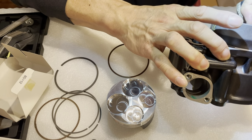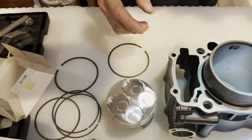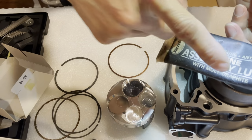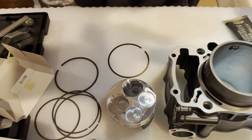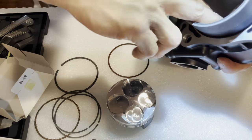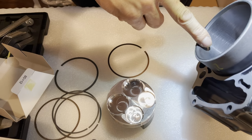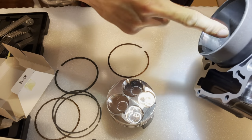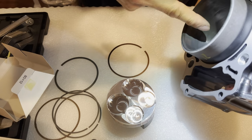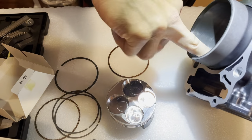I haven't used this thing in a long time. So this is kind of like a grease almost. It's a moly graphite, right? Molybdenum. Usually that's what you want when you're putting together an engine. You want to use a lot of molybdenum. So I'm just gonna smear this on here all the way around. And graphite is also a lubricant. Graphite is actually a dry lubricant, or you could use it as a dry lubricant.